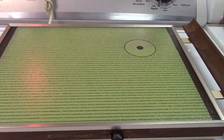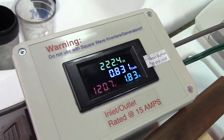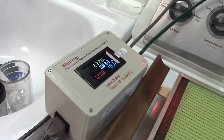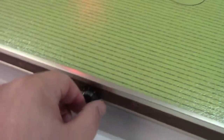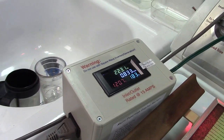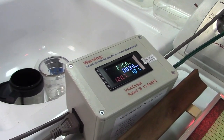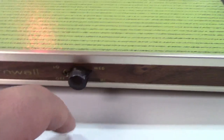The last thing we'll do is plug the watt meter in and see what it says. It said 220 watts — it's reading 222.4, going up to 0.7, 0.9. Now it's going down a little. If I twiddle the thermostat — it's all the way on high — I'll back it down slowly and go back up. Right here on medium is where it's turning on and off.